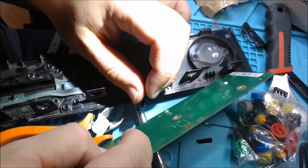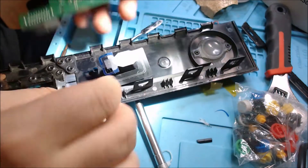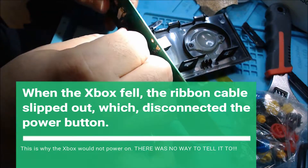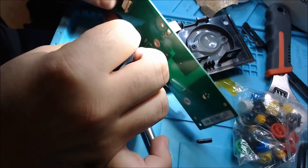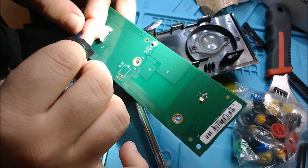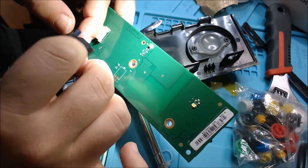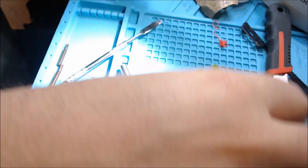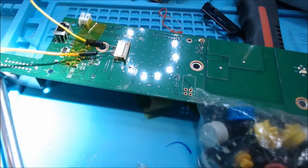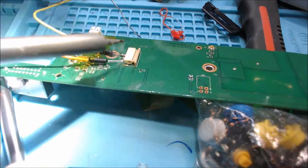So I decided I was going to have to hardwire a cable directly to the board. This is the port that the ribbon cable actually slipped out of. I'm trying to figure out which pins the sync button touched on that port, because those are the pins I'm going to solder the button directly to — so this Xbox will still be able to do the sync function with a new button.